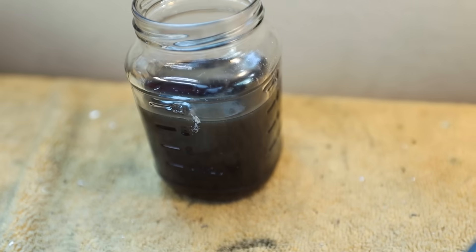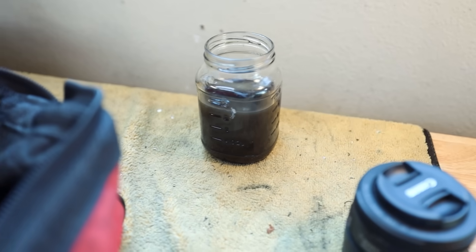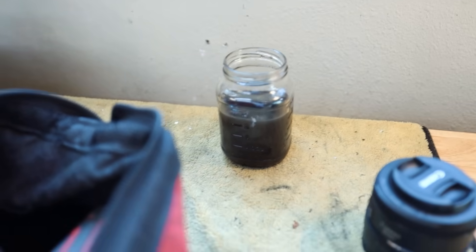For the first oil in the car, use cheap conventional oil because you're going to do an oil change right after the cam break-in. Once cam break-in is done and it's been about 20 minutes, shut the car off and get that old conventional oil out. By doing that, you're pulling out old assembly lube that might still be floating around, any material that may have come loose, and anything else still in the engine — get it out before you drive the car.